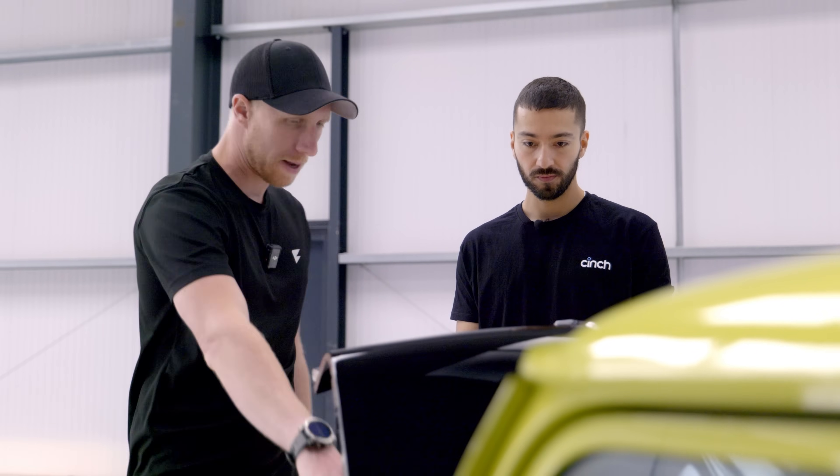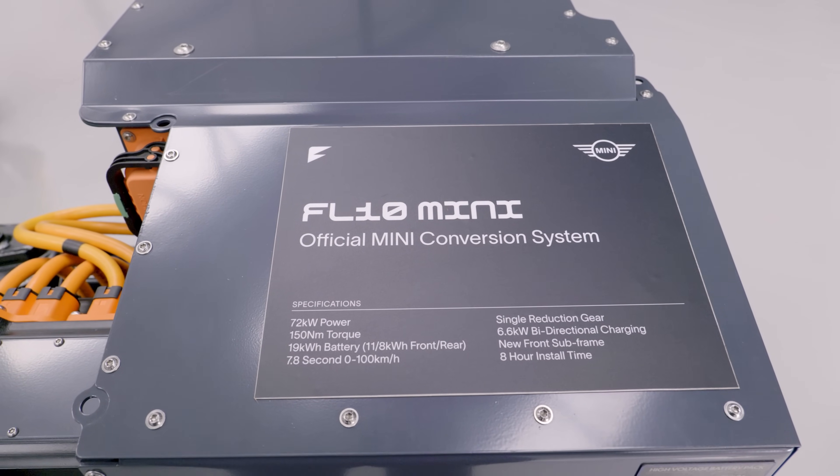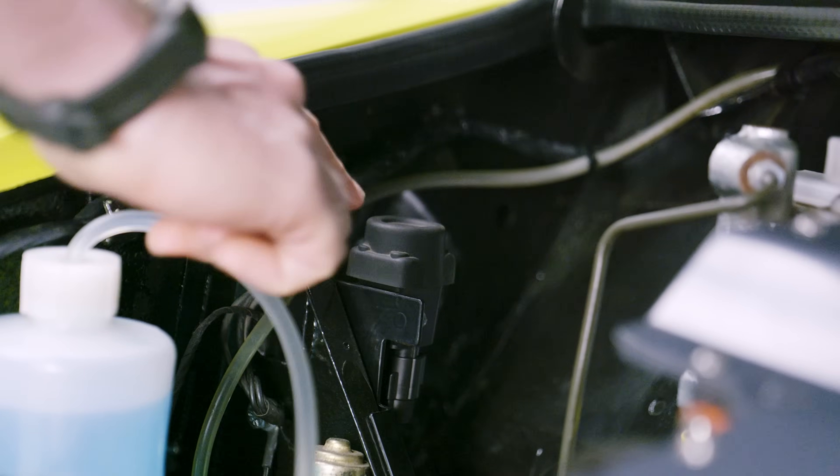Basically we've got five battery modules in here, with busbars and all of our contactors and all of our clever electronics to make sure it's safe. You've got a safety disconnect in there, so if there were an issue you can pull that out to shut the vehicle down — all the modern EV safety features. There's a crash sensor just there — if it ever crashed, it would shut the whole system down and make it safe. It's about making not just an EV but making it as safe as possible. Minis were never going to be crash-safe anyway, but we've gone as far as we possibly can.